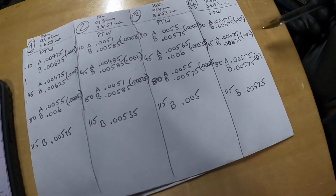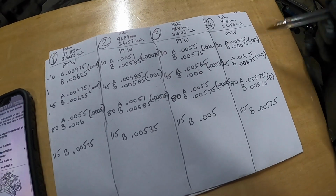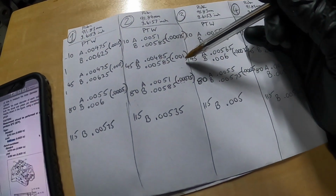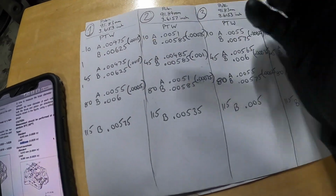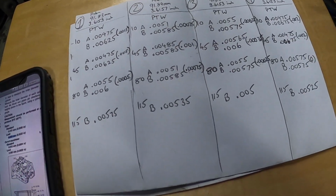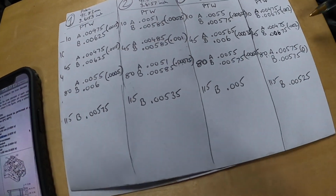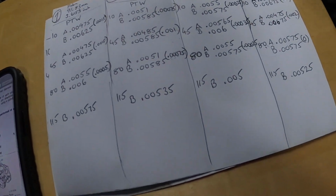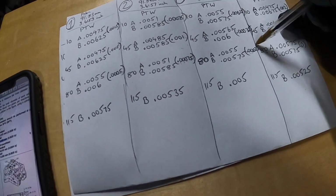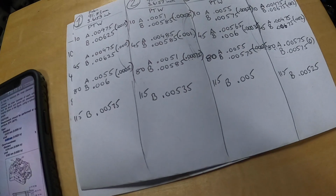Alright boys, went around and worked out the differences. So for the roundness, worst one is actually piston cylinder 4, but everything else is pretty close. This one tapers in at 45, tapers in, goes straight. This one, yeah, need to work on that one. Definitely need to work on from 45 up. We are dead circle at 80, so yeah, we really need to work on that top section. But yeah, it tapers in a bit, but that's all right.